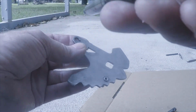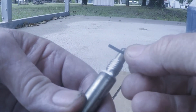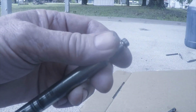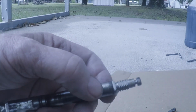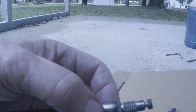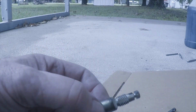And the only way to get this shaft out is to take the valve body out, because it's got this pin that goes in that groove to hold that shaft, and this pin is trapped by the valve body. And I don't want to take the valve body off because I'm not that good of a transmission man, and all those little check balls, there's like 5 of them up in there, and if you've got the transmission upside down on the bench, they all stay in the right grooves. But with it inside this motorhome, they're all going to fall off, go everywhere.